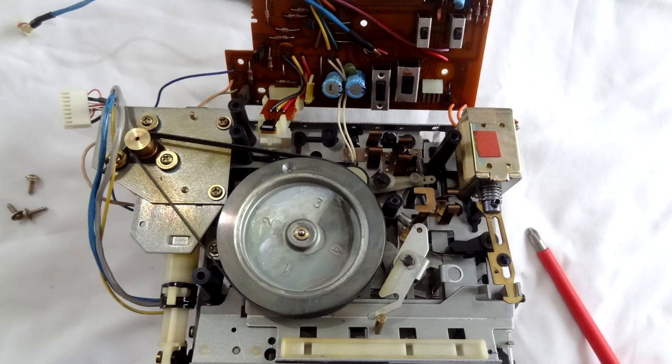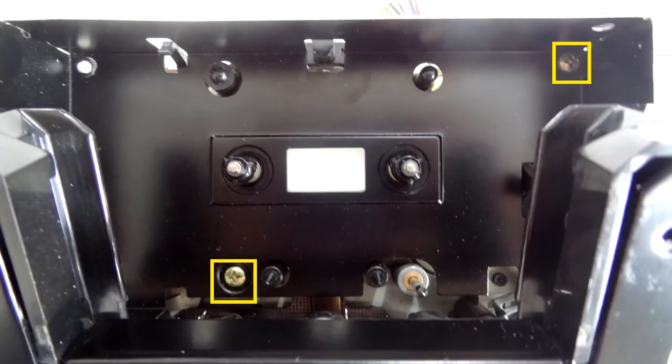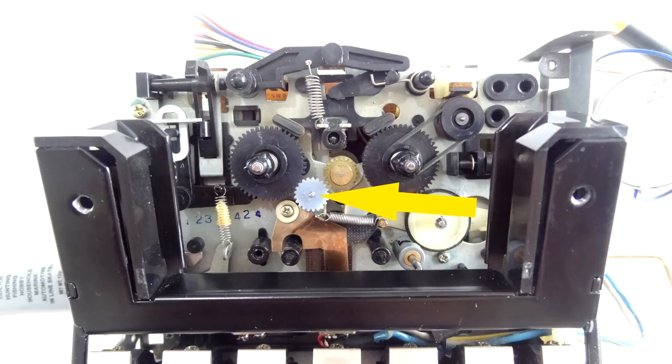Once you do that, I'm going to show you — not here but when I go back to talking to camera — exactly how I put the rubber back onto the flywheel. So that's the wheel for now. We're going to go over to the front and take these two screws out to get to the front. Now once we've taken them out, you'll be presented with this. The yellow arrow shows the new cog I've just put in there. If yours has disintegrated or disappeared, you're going to have nothing there — and that's where your new cog goes.